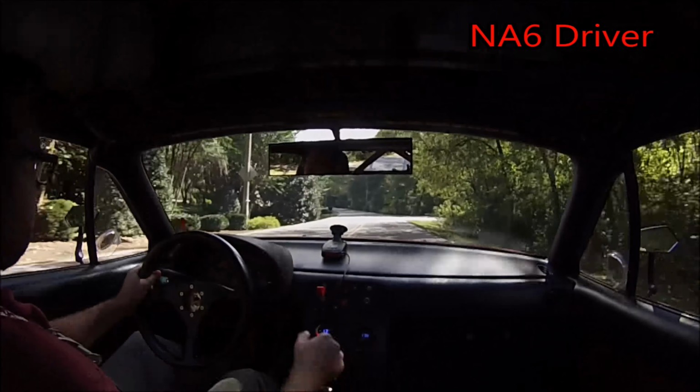I came out here the other day and I noticed some oil, or I thought it was oil, up underneath the car. Didn't think it was that big of a deal because it's a turbo car and it's got over 100 and something thousand miles on it, and it's been turbo for about 2.5 years now, and I expect some oil seepage through some of the seals and things. I kept seeing it underneath different frame rails and stuff, and it wasn't quite up underneath the sump or the back where the rear main is next to the transmission.